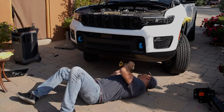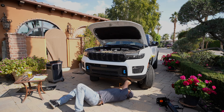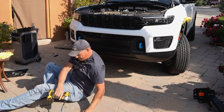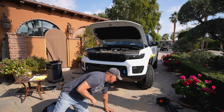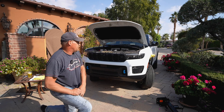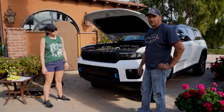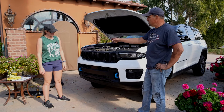It's a shame you don't have that little dolly to get under the car right now. I don't have a lift so I have to get on my back. So we got the nine bolts off the bottom, and now we'll move on to a few electrical connections and then begin to pull off the front fascia. At this point we've got all the bolts off the top, all the bolts off the sides, all the bolts off the bottom — and now it's time to phone a friend because pulling the fascia off the front is a lot easier if you have somebody on either side.